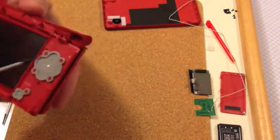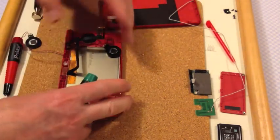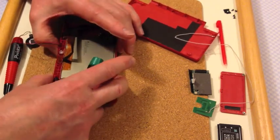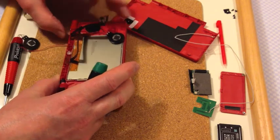On this particular one it's quite solid, so what I've had to do is push a screwdriver in there to release this block here to get to that hinge. Now I can lift that gently, but don't pull it because the cables actually run through a tube here at the other side that has to be gently released.